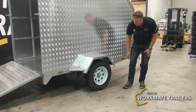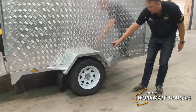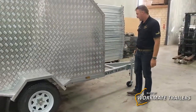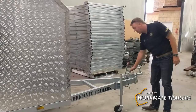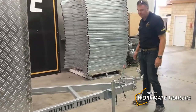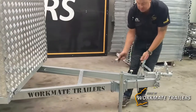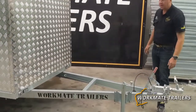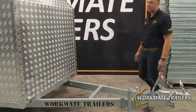Light truck tires as standard, mounted up on a Ford 5 stud pattern, 45 mil solid axle. Coming around the front, cabled up to mechanical disc brakes, two ton towing gear, free jockey wheel. All our trailers are fitted with a seven pin round plug. Carrying capacity is 940 kilos of payload.